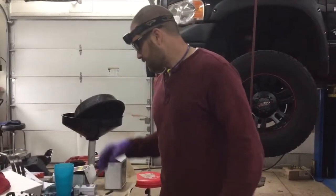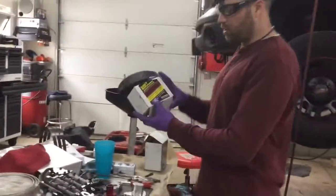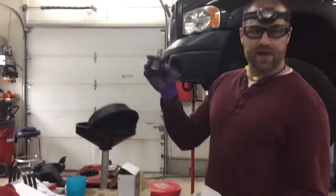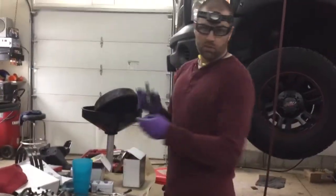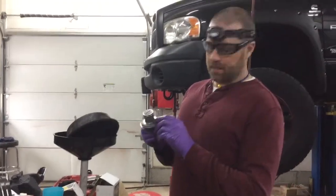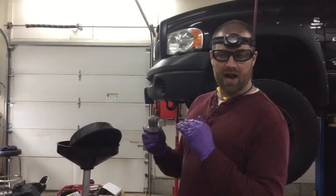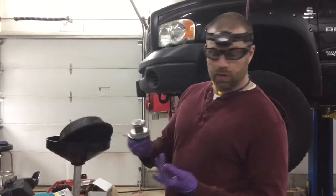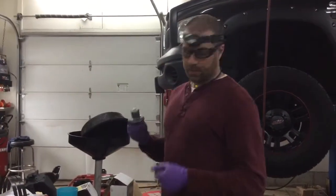I'm doing it right. The other thing I did for an upgrade is what they call the super servo. This piece here goes into the transmission itself. That's the factory one. The aftermarket one, which is already in, gives 11% more sealing power and holding force than the factory one. It firms up your first-to-second and second-to-third shifts as far as shifting into and coming out of gear.